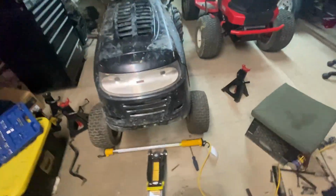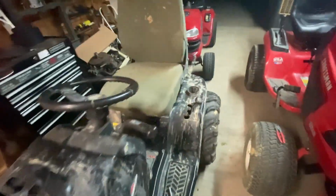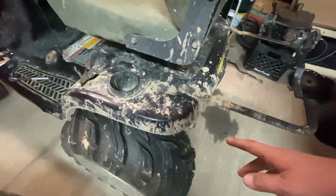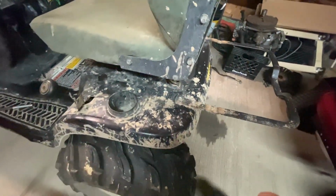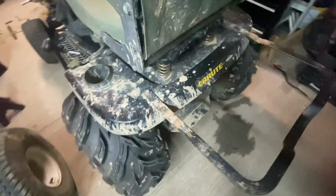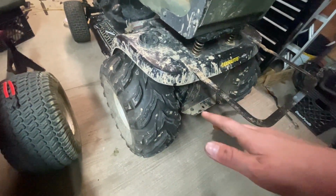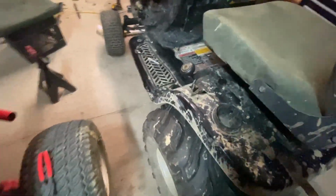But pretty much some of these with the pedal, most of them with the pedal, have a different transmission case in the back. So there's a bolt and some bushings or bearings running through the case in the back there to run your variator drive pulley on. This one's mounted to the frame. Weird. Unique though. And that means any FNR transmission will work in this mower, which is good. I can use any one of them in this.